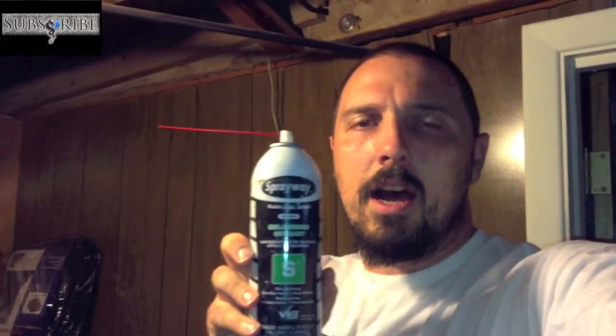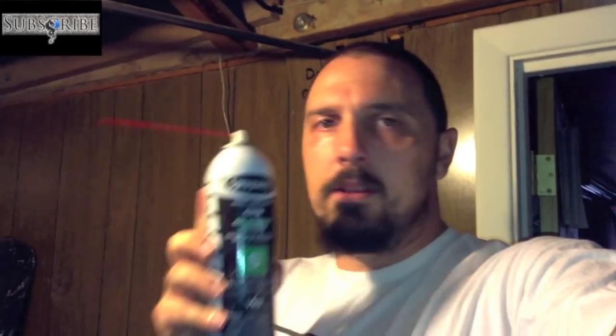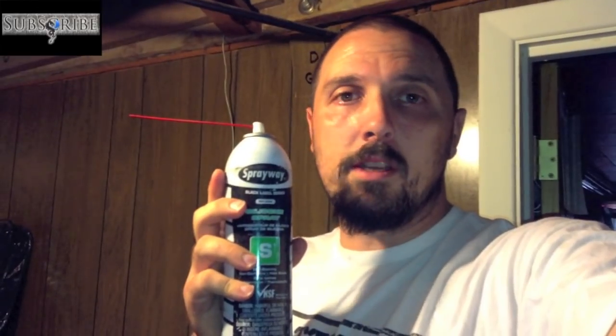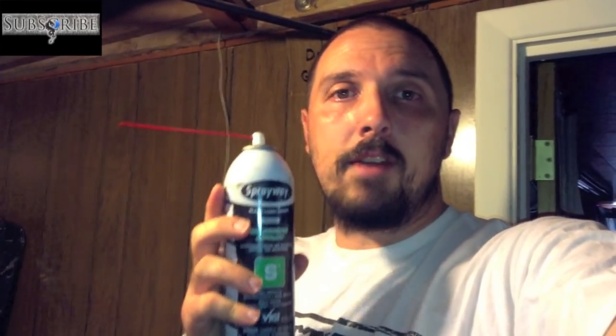So Sprayway - I'm not getting paid - but their silicone spray is great. You can also get it by Liquid Wrench. Don't use WD-40 on stuff - that'll de-grease it and then you'll have no lube. If you're going to use WD-40, you have to clean it after and use some sort of grease or lubricant afterward. I sprayed some of that on all the pulleys and was able to free up the small pulley, which allowed the water pump to drain the washer. Because this is a belt drive, not a direct drive.